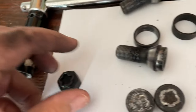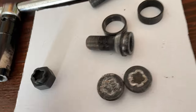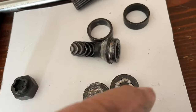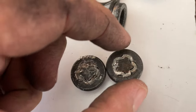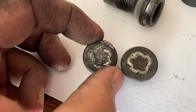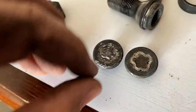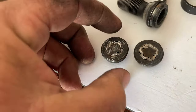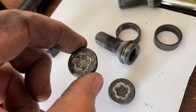Where I started was just trying to get the broken key piece out, thinking that shouldn't be too hard — but when it breaks, it's actually like a spring form in that it's not loose in there at all. I tried with a strong magnet, I tried with little tools with super fine points to try and hook it out, and it wasn't moving a millimeter on both cars. Then it was like: okay, hit it with a chisel, just keep banging until it pops out. Over three or four nights I kept going, trying to hit it with a chisel to get it to turn, but because the nut was broken it was super tight. The depth it was sitting at made chiseling an extremely difficult task — no success with that either.